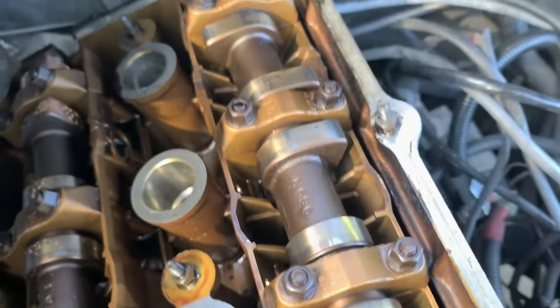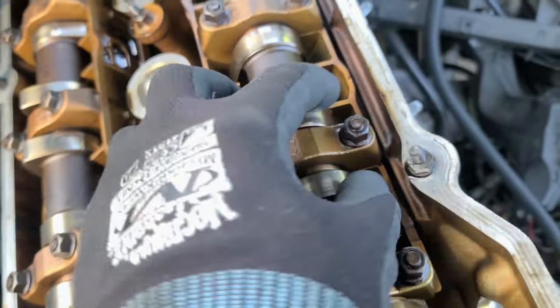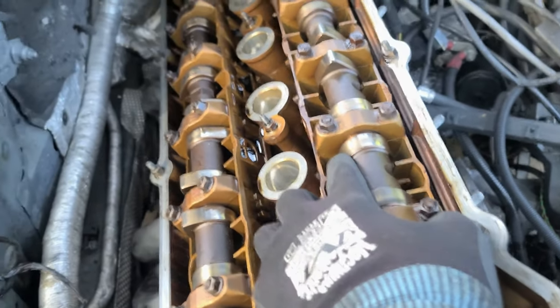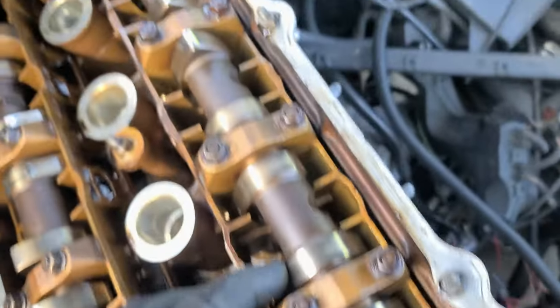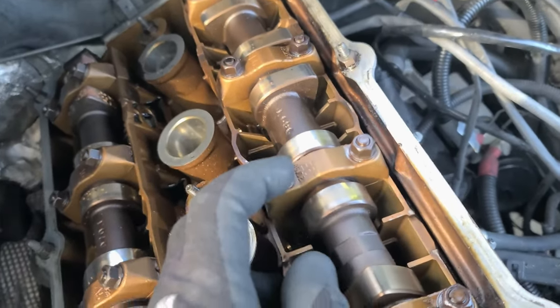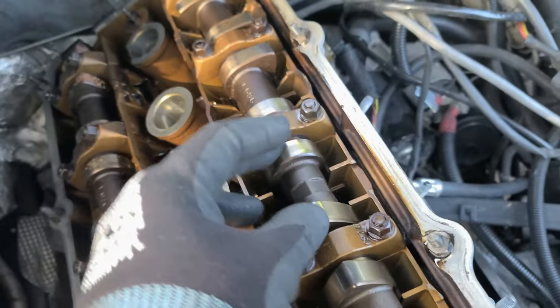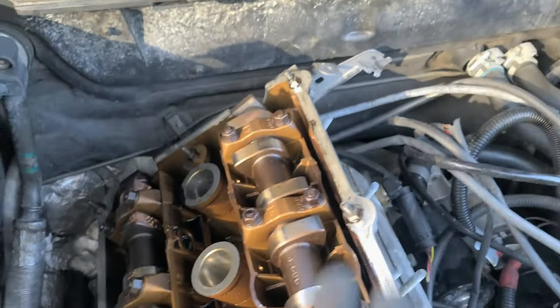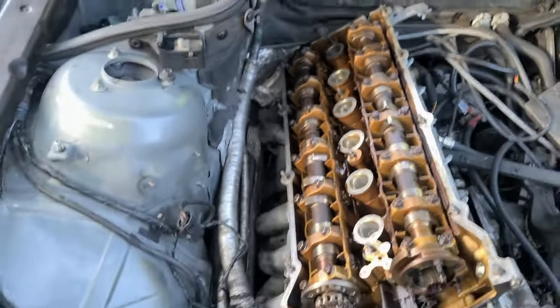Therefore, those that face down apply the most pressure, and you can figure out which ones if you turn the cam so that the points actually face down on even sides. For example, this is the first cylinder, this one second, facing down, and fourth, which is 6, 5, 4th. Here we go. Therefore, you want to distribute the load so that you start from the back and front and then work the middle section so that it doesn't crack, and that's what I'm gonna do.